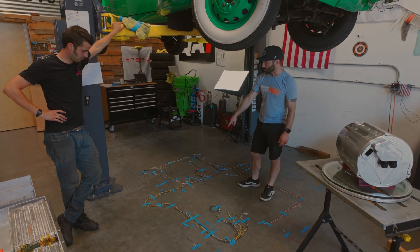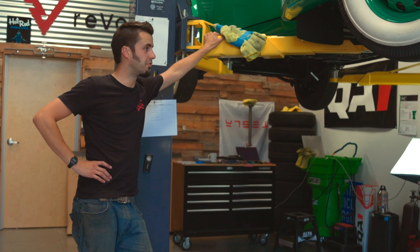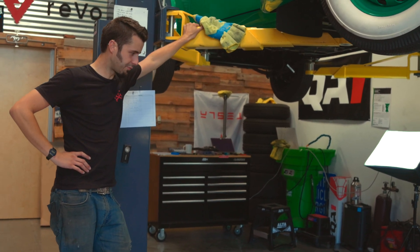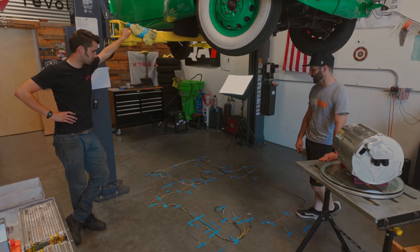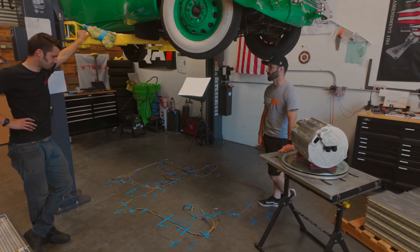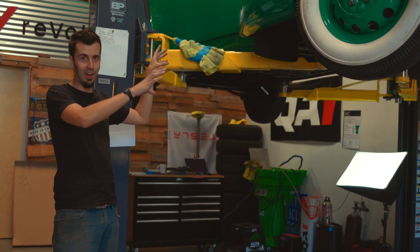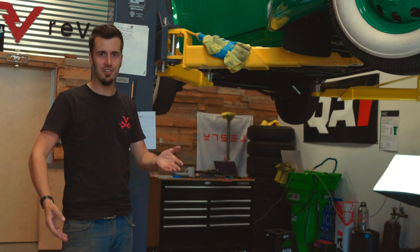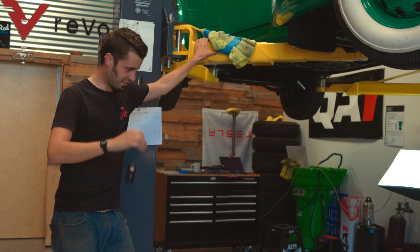I'm seeing a lot more twisted pairs in this one. The AEM system uses a lot more CAN lines — we've got three CAN channels on the VCU 275: the AEM side, the ICE Spy, and the T2C CAN. It'll probably double or triple before I'm done. This is the first time I've done one laid out like this — figure out where the components are in the car, measure the distance from each one to each one, figure out where you're going to run the wires, and then you have your dimensions. You cut the wire the right length and put it in — this is the way to do it.